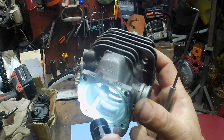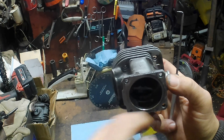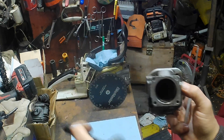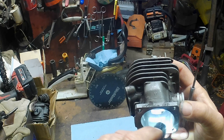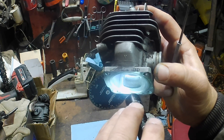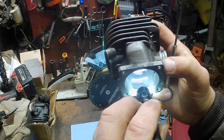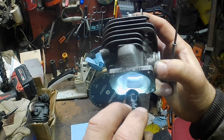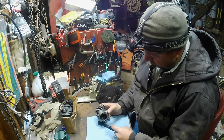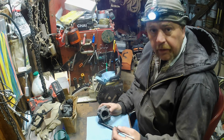You can see some lines in there — I drew them on — you can see the different wear pattern, and what that wear pattern's from is the edge of those piston skirts, right here and right here. All the air that gets to come in the bottom of your crankcase gets to run up there. You can widen these out to that wear line — there's nothing to prohibit you from widening that out — and a lot of times that'll help runnability of a saw. I personally like a bigger lower transfer down here; I like getting that metal out of the way.